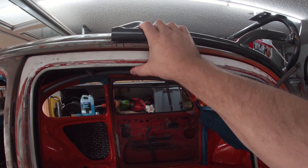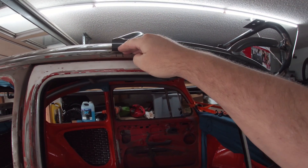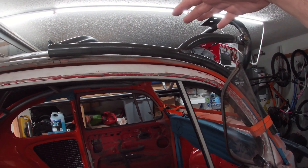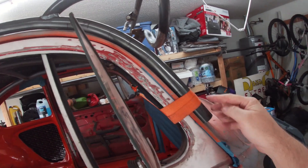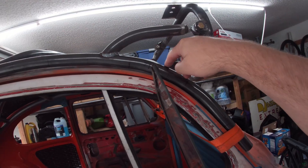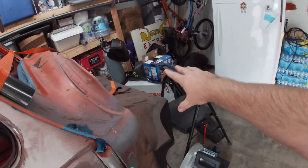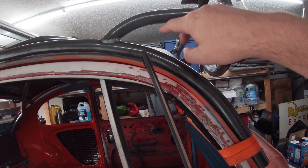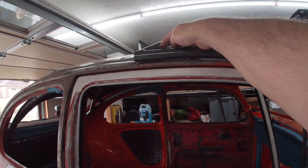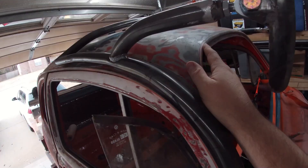What's next? I need to make mounts for this. Today I'm going to start doing that. I'm going to take some wood — about an inch or half an inch — and put it up underneath on both sides. That'll raise it up an exact amount, make sure everything is kosher. I'm probably going to trim this down and cut it off here and 45 it. I want to put a nice 180 bend. I've got some one-inch tube for the front bumper push bar, and that'll make a nice tight bend. This is inch and a quarter, and the new tube will be one inch, so it'll sit inset. I might do the same thing on the other side — put a 180 there to tie it all in. Let's get started.